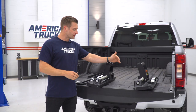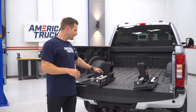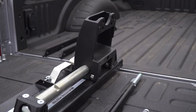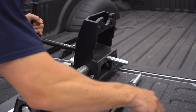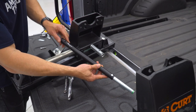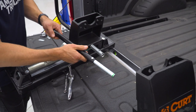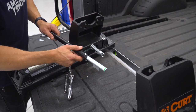Getting started, lay the slider system out on the tailgate so once it's assembled it's a short trip to the puck system. Make sure the driver's side rail has the green sticker facing the cab. First, grab the locking handle system — both sides, along with the included spring and bolt. Take the portion with the handle on the driver's side and fish it through the hole. Insert the spring, then compress it enough to get the bolt through the hole and secure with the nylock nut. Make sure the keyed portion is facing down — that's very important.